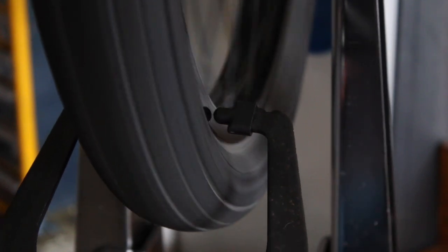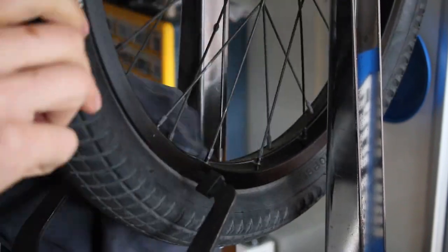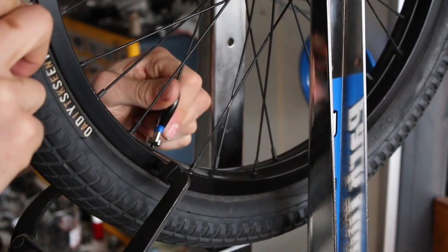Now that the front is all built up, I'm going to start work on the rear. This is one of the first wheels I ever built. As you can see, it's pretty buckled with a fair few hops. I'm going to true it up the best I can and see how it goes. I actually followed a YouTube video about eight or so years ago and it showed me how to lace it like this. The only thing wrong with it is that the valve hole isn't in the right place — it's in between the crossing spokes.